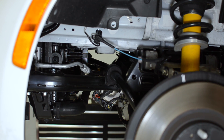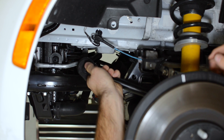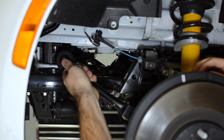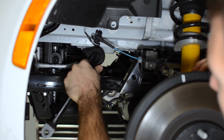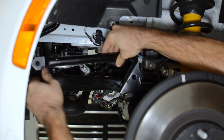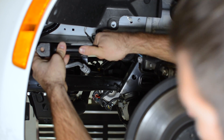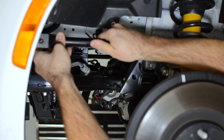We're now on the left-hand side of the car. I'm going to go through the series of steps of removing the front sway bar. We're going to rotate the bar up and move it forward like we did on the right-hand side. Then we're going to pull it slightly towards you and do a complete rotation so that the bar is now in the nine o'clock position. Then start working the bar towards the back of the car until it pops up and over.